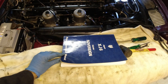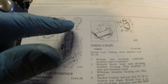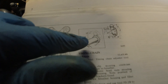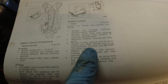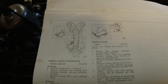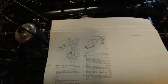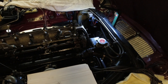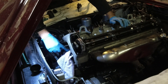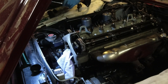To make it a little bit easier to understand, I grabbed the manual to show you guys. Here are some great pictures. You can see the lower timing chain goes up there, and then you have the upper timing chain there — and there's the tensioner we're seeing. That's what it looks like with the tool in place. As the manual says, rotate the tool in an anti-clockwise direction and do not use undue force. You can also see the other chain tensioner down there. The rag is just in case anything were to fly off and fall down — we're being overly cautious.